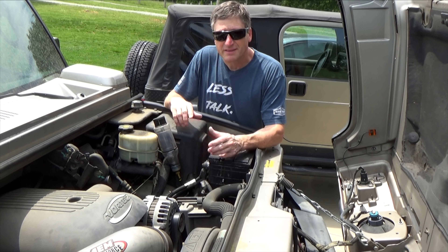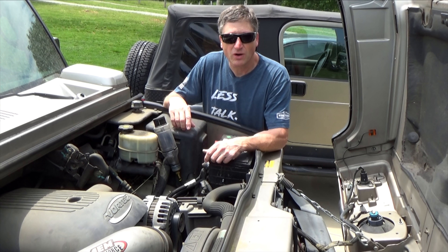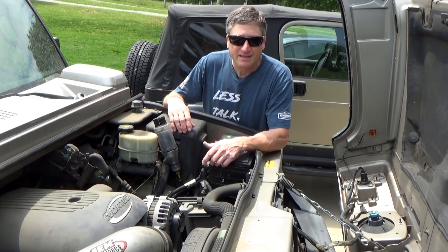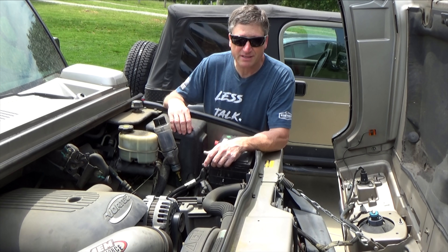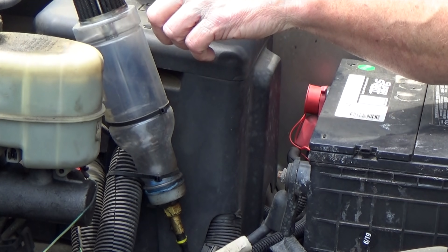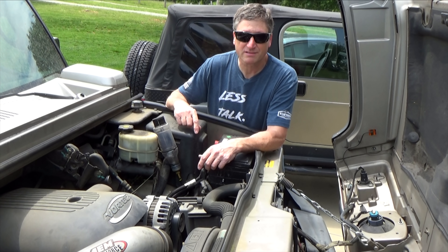Here's the issue. These Hummers had a real small diameter vent hose and there wasn't enough room inside the hose to allow the gear lube to burp itself back down into the axle, so it always leaked. I was going on a beach trip in North Carolina and I really didn't want my stuff leaking gear lube on the beach, so I made this quick temporary expansion tank out of a plastic bottle, a barbed fitting, and a breather. Well, that was ten years ago and it's starting to leak again, so it's time for a permanent solution.